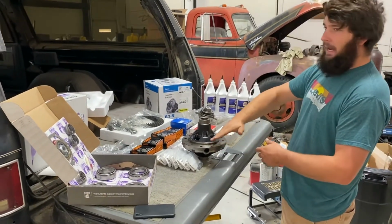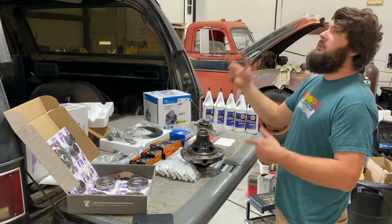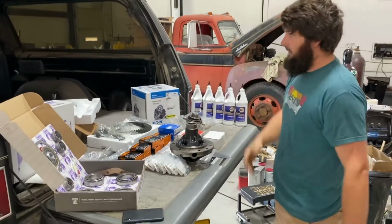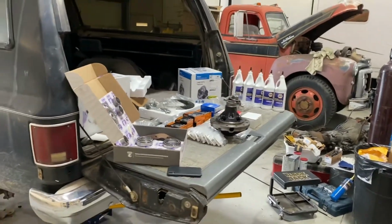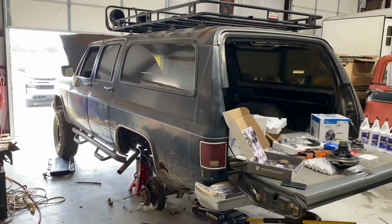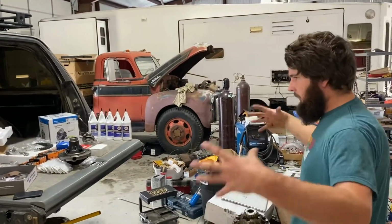The 411 and down, or 411 down to I think 320-something was the highest or the lowest. See, it's why it's confusing. The lowest gears you could get numerically for highway speed, which your Suburban has factory 410s, and the GM corporate kind of a Dana 44, whatever the hell Chevrolet did there. This is a factory 410 rig. That axle, we pulled it apart from sitting for 10 years, was in pristine condition. Was impressed after sitting that long. The gears are beautiful. So that required nothing except for hub assemblies.